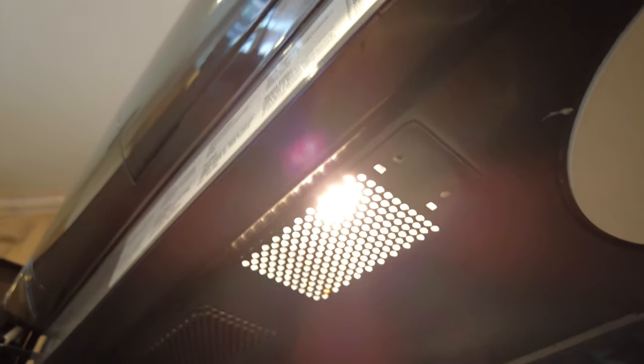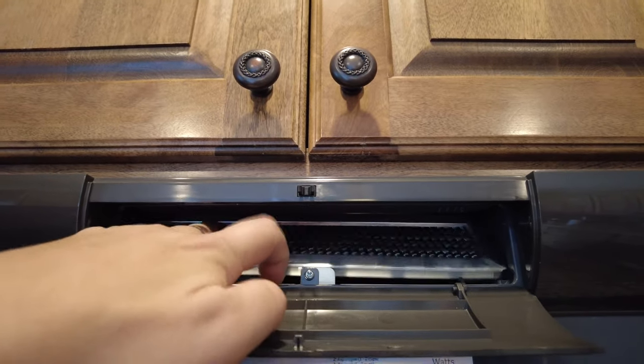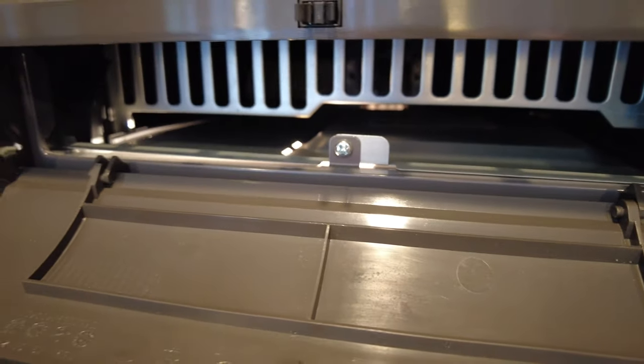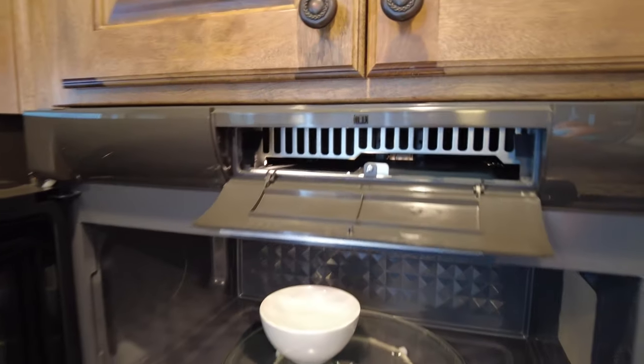One question was how hard is it to change the light bulb. There are actually two light bulbs underneath here. All you have to do is remove this cover with the screw and then you can pull the light bulb out — it's a really easy process. We'll have a link in the description to the actual PDF from GE explaining everything you have to do to change the light bulb. As far as the light bulb on the inside of the microwave, it's a little more complicated. You actually have to pull out this air filter up here in order to access where the light bulb is up top. So it's a lot harder to get to — you go through this vent filter right above the microwave, and this is actually behind the door itself, so you have to open the door to get to this access port.